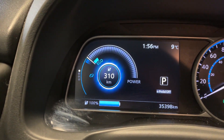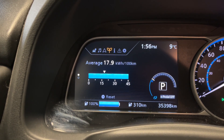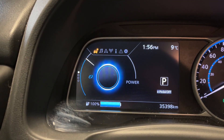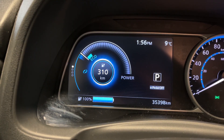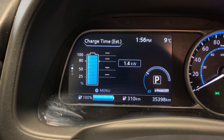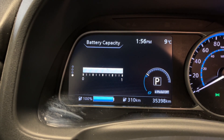If you go left or right, at the top you can see Music, GPS, and Leaf. I'm using the left arrow to move left, and you want to go to the furthest left item — the car with the little plug on it. Then scroll down to the lowest item; there are a couple of menus including temperature, but the last one is Battery Capacity — that's where you want to get to.